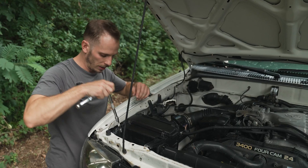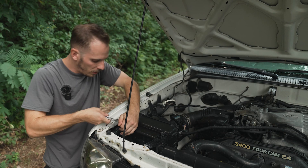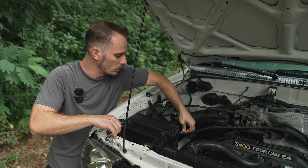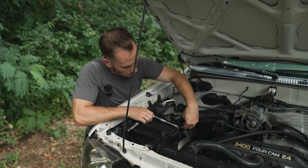To get the best angle this time around, I'm going to take out the air intake box, which is held on by two 12mm bolts. I'll take those out and also disconnect the hose here and this hose right here. This little clamp should be a 10mm — yep.